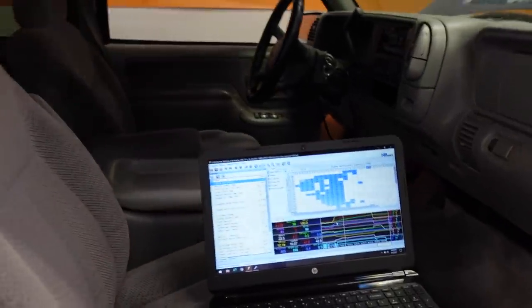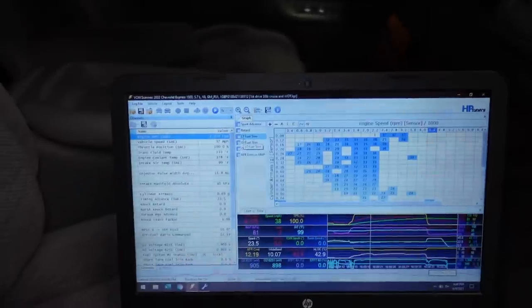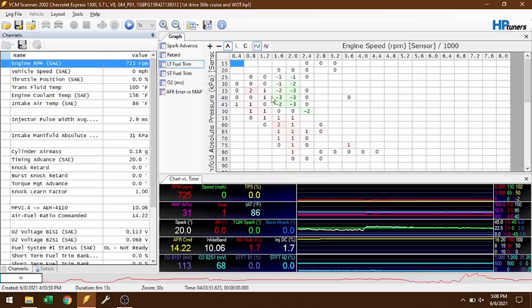Anyhow, HP Tuners VCM Scanner, this is kind of what we look at. I'll put a screen capture on here. Long-term fuel trims are positive 2 to minus 2, minus 3, so this is spot on. Short-term fuel trims are usually a little bit further apart. We've got negative 2, positive 5, a couple of positive 7s and 8s. Overall, though, I would say this injector data is exactly where it needs to be,